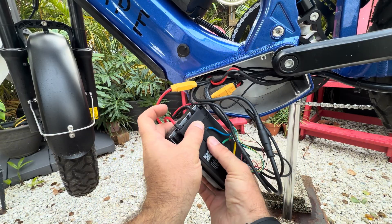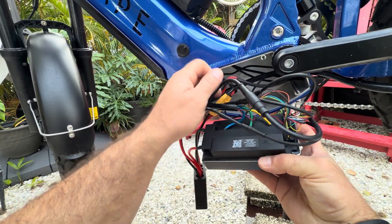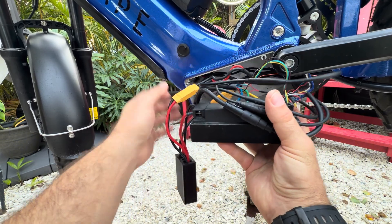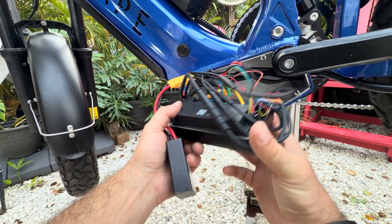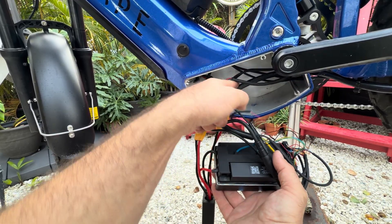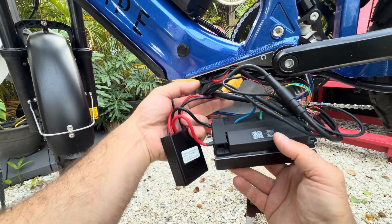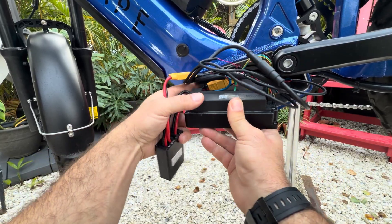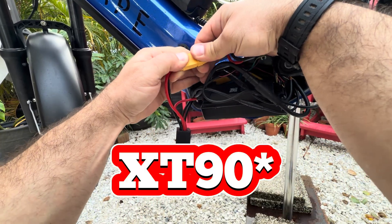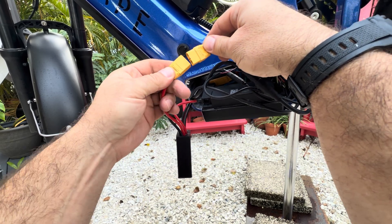On the Magician it's got an IPX waterproof rating, but this does not feel waterproof to me, and I'm not sure if Escape has advertised it as such. There's never a point where you'd find me risking that with my e-bikes regardless. If you want to waterproof something you're going to need to seal this compartment along the edges. There's also a hole in the bottom that serves as a vent — you don't want to just seal off your bike and forget you've done it and then have to deal with moisture problems.